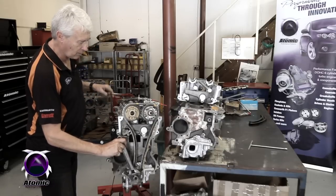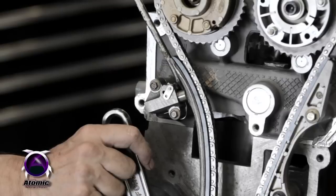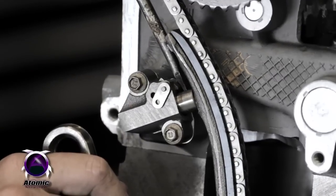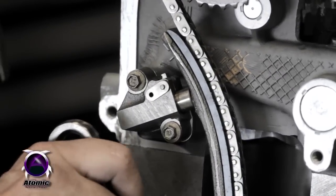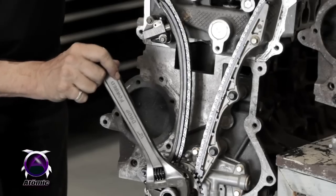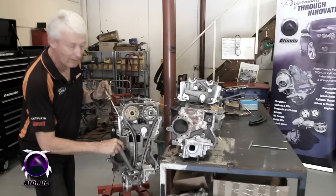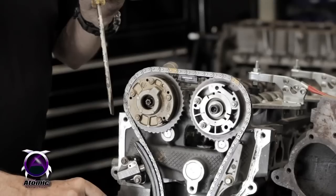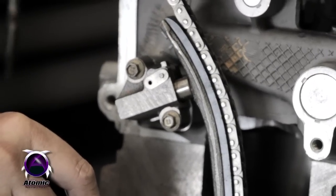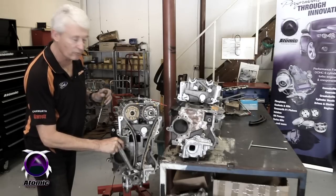Sometimes when you're putting the motor back together again you just need to give it a little bit of a helping hand onto the next tooth — with a screwdriver, and you can do that from the top. See how it's just engaged into the next tooth? Two teeth. Now you can see it's relatively tensioned, but it still needs to go one more — see the rocking action there? That will happen when you start the motor up. If you run the motor for a short period of time it all settles itself out, but we like to just give them a little bit of preload to get them up and running into the correct position for when they first start.